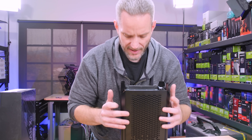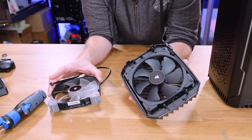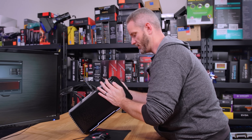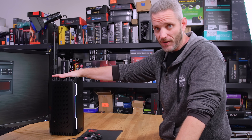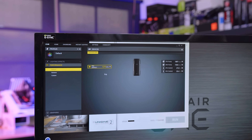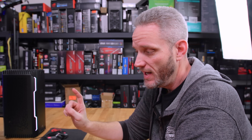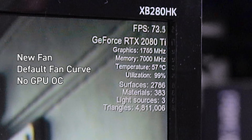So I'm going to switch out this fan with the Maglev fan, overclock it a bit, and see how much of an improvement we get. If you can't figure out how to upgrade the fan, you probably shouldn't be upgrading anything in this system — it's literally four screws, just make sure the orientation is pulling air out the top. In terms of acoustics with the new fan, yes you can hear it — it's not the quietest system in the world, but it's quieter than some of my other builds since it's just one fan. With the fan set to default, 60% of 2000 RPM is clearly higher than 60% of 1500, so we're moving more air with the same fan curve. After running for about 20 minutes, we're dancing between 56 and 57 degrees with the core speed at around 1755 MHz, and the iCUE software showing only 1500 RPM.